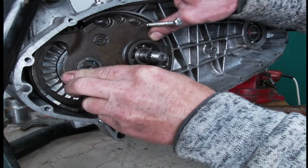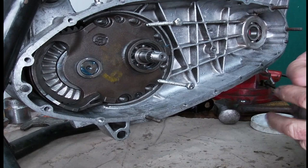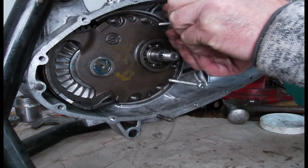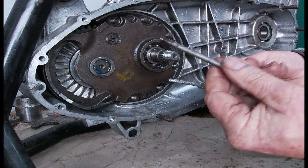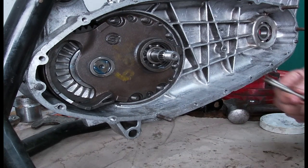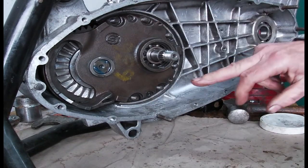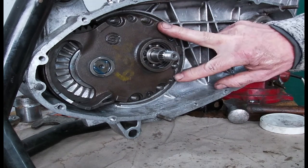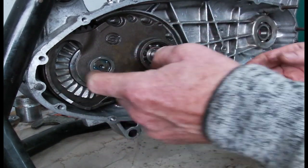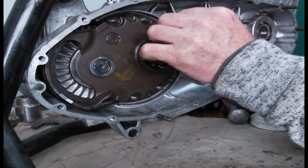And on we go — should go pretty easy. Yep, that's done. We can put all the rest of our shims away now. So there we go, it's just a matter of bolting it up. If you use nice long 10 mils you can use T-bars — you can make them up yourself. A couple of long 10 mils are good because you can get a good hold on them to pull it off. These are the extraction points — they're not central, not exactly opposite, so you need to leave a little bit on this side to get it off. And we put on our lock washers.